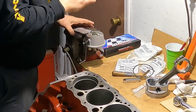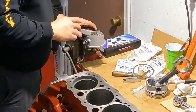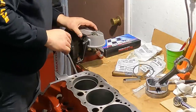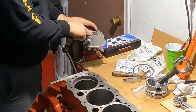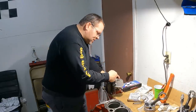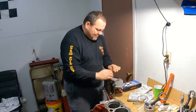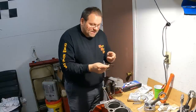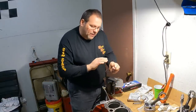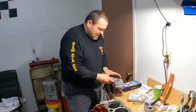All right. If you file fit rings, I'm going to push this up on my file here. I've got my hands squeezing and I'm pushing forward on my two pins here. Okay. And then when I turn this, you only turn them into the ring. It's real important that your cutting wheel cuts into the ring, not away from the ring. The reason is you always want that edge of the ring to have the material cut back into it, never out from it. We do not want to create a sharp burr edge on this at all.